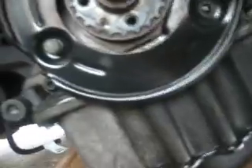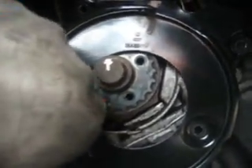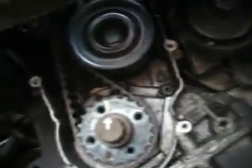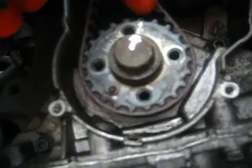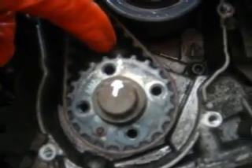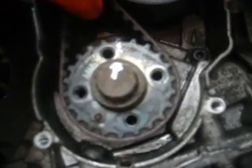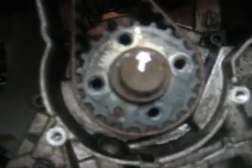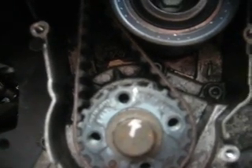Here's the cam. A quick little suggestion with your main crank sprocket — this sprocket has three little dots. There's one, two, three. And this top one, the leftmost one, should line up with a little divot. There's a little casting piece behind it. That should line up and you would be approximately at top dead center.